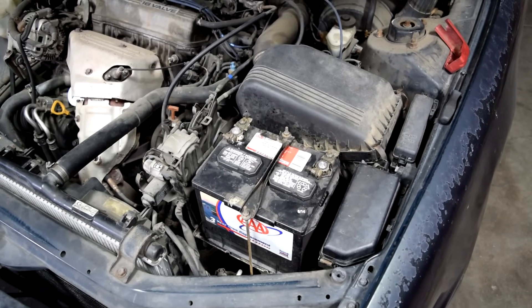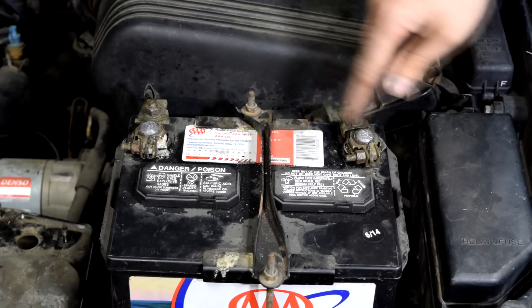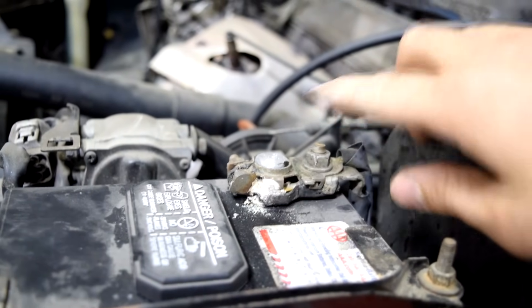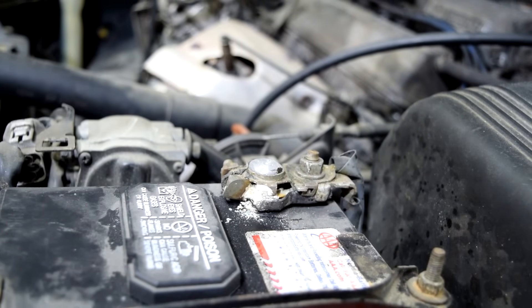About 8 or 9 times out of 10 when this happens it means there's a problem with your car's battery. So a good first step would be to do a visual inspection of your battery terminals and battery terminal connectors. Make sure they're not damaged or loose. Also look for signs of excessive corrosion — if this corrosion buildup is excessive it's not going to allow enough current to go from your battery to start, therefore not allowing your car to start.